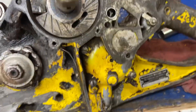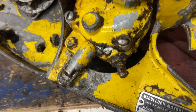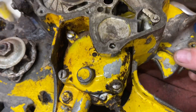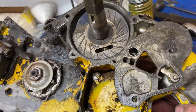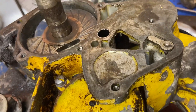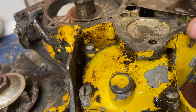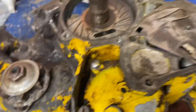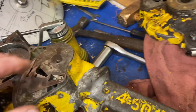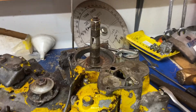I don't know how this carburetor works — I don't even think it's a carburetor. It's some sort of fuel flow that you manage. There's a big adjustment on the bottom and some sort of adjustment down here. This is weird — I've never had one of these apart. There's your throttle, and on the throttle there's like this plate. That throttle is pushing that plate, which is letting your fuel in to the rotor to get the fuel into the engine.